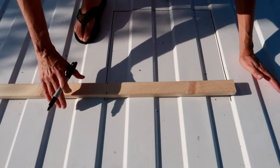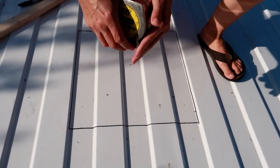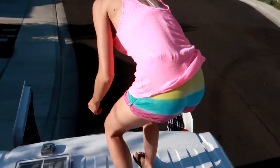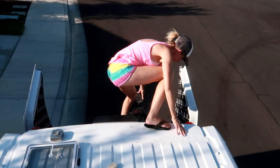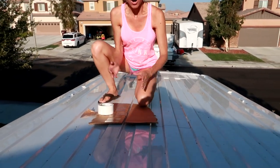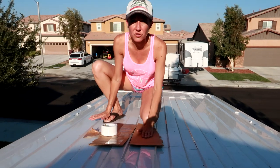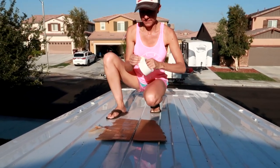Measure six times, cut once. We're going to have to get a drill bit to cut through and the metal jigsaw blade to do that. I am going to use duct tape and cardboard — I'm going to tape these down with the line that needs to be cut down the middle. The reason for that is on the saw we're going to use, there are metal pieces to help you go smoothly across the roof. We don't want the metal pieces scraping on our roof, so we tape down this cardboard so the metal pieces can glide along and cut a nice straight line — and not scratch the paint off the roof.